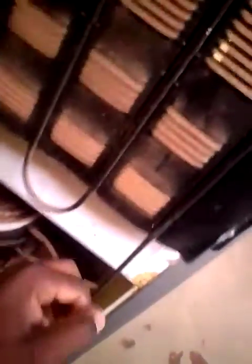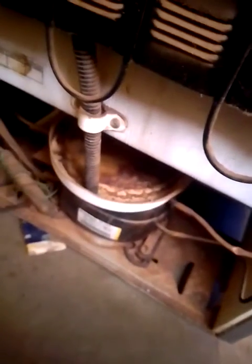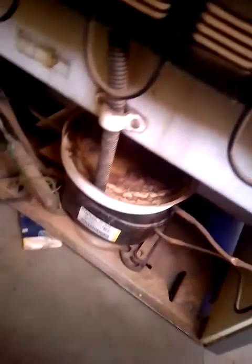What you have to do first is check at the back. You have to look at the discharge pipe — as you can see, this is our compressor right there, and this is our discharge pipe which is going to the condenser. If you touch it here it's warm, but not that hot. Then check this coil — this one is 100% cold. So we know that we're out of refrigerant, or the compressor is not working fine.